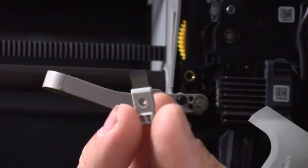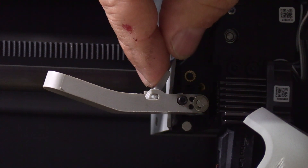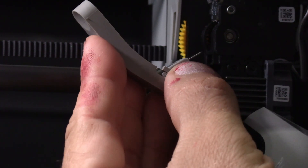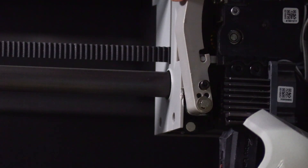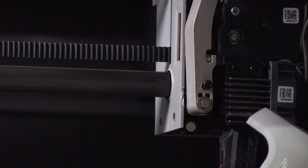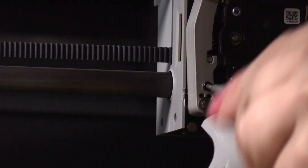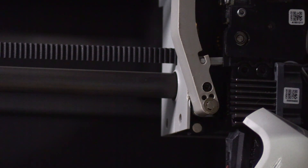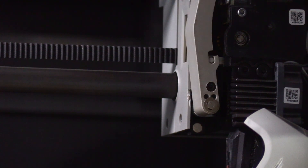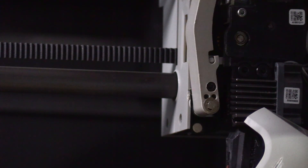Go ahead and grab your new one. Reach in there, slide it into place, and press it forward. Gently lift this up. You will notice there is a slot in the side of the machine. The blade goes into that slot, and you should be able to freely and smoothly move into that slot. Holding the lever in place, retighten the screw. Do not over tighten. This screw serves a different purpose than a typical screw — it's actually butting up against a notch, keeping the spring from being forced open. Therefore, you do not need to tighten it, just snug enough that it functions properly.